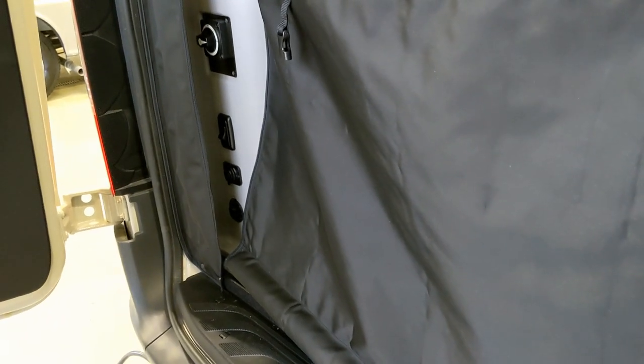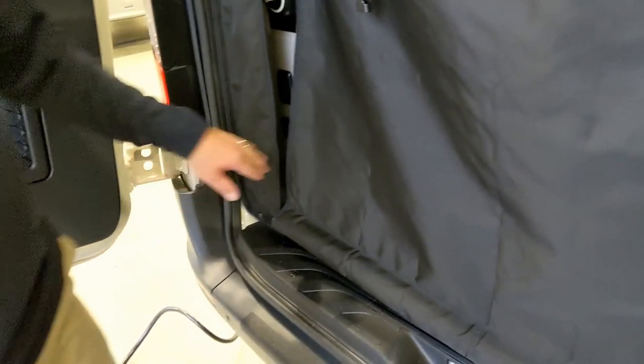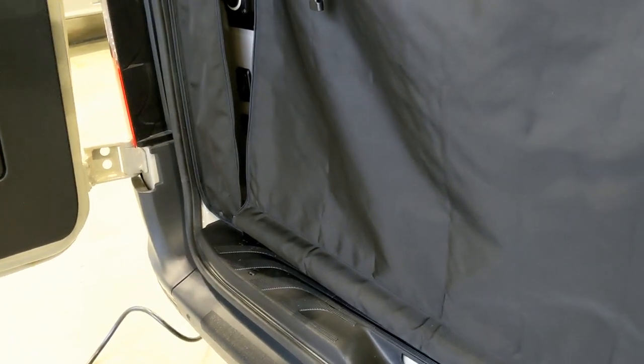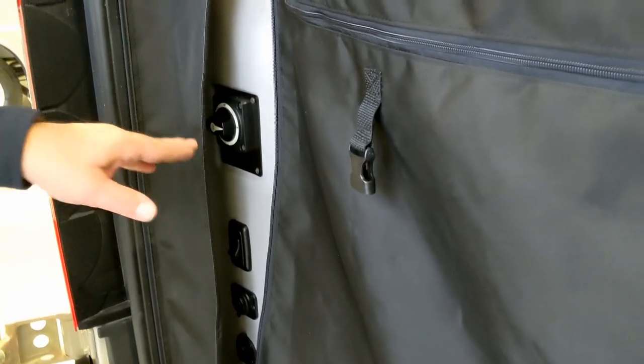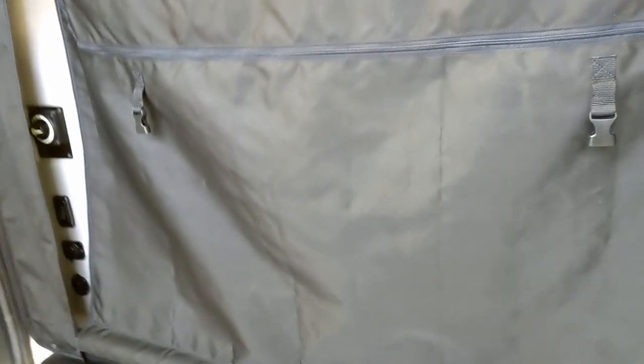To use an auxiliary panel you can shut the rear door — there's enough clearance at the seal. When buying an extra solar panel, don't spend money on a controller — you just need the panel and the cord with the right connector. There's also another main power switch for the inverter out here — the only time you'd shut this off is for storage. If you can't get the inverter on inside, double-check this switch. For deep sleep/storage, just shut this off completely.